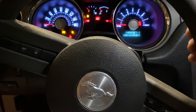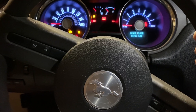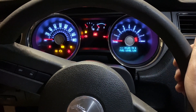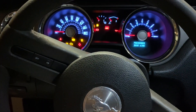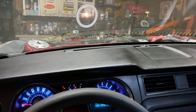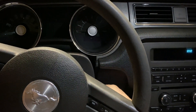We got all kinds of faults. I have no idea what it's doing. It thinks the doors are open - obviously the driver's door is open but the passenger one is not. So it looks like I'm gonna have to change the harness inside the door so they communicate. I hope that's all it is. But trunk latch works, horn works, headlights work, brights work, turn signals, radio - we don't have an antenna hooked up yet - but anyway, there it is.